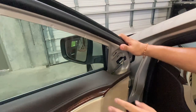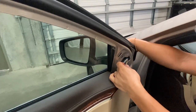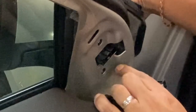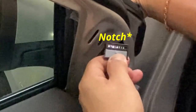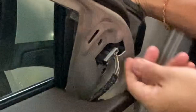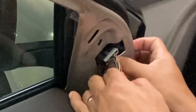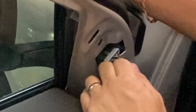Alright, get your hand, hold the base of the mirror, and then unplug it. This one's a little tricky. To unplug this mirror you're going to have to push down on this little tab on the bottom. Push down this tab and then it'll come off the little holder right here. Put your fingernail or something flat like a flat head, lay it down — and then it comes off.